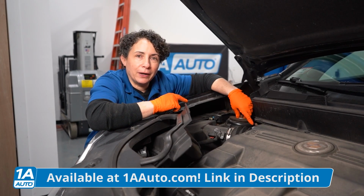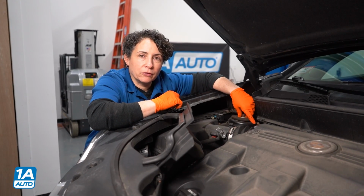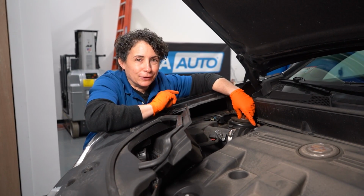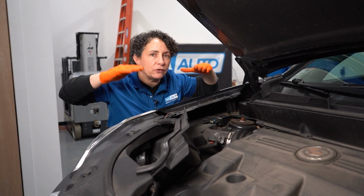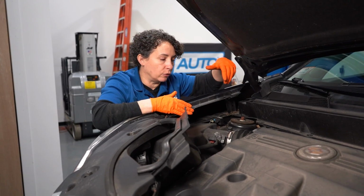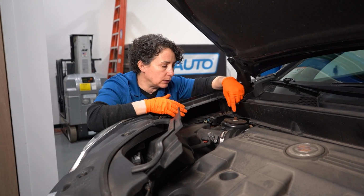It's kind of like your body, right? My foot hurts, doc. Well, your upper leg muscle's broken. The end result would be the foot, but it's not the foot that's caused the problem. But if you think you have strut banging noises, and you don't have a sway bar link problem, you don't think you have an internal strut problem, could be with strut caps. So let's check this out.